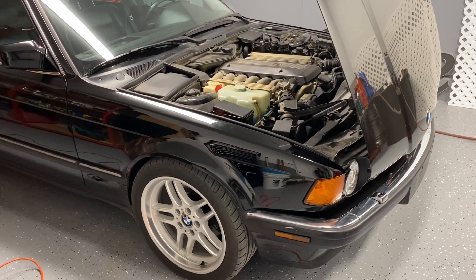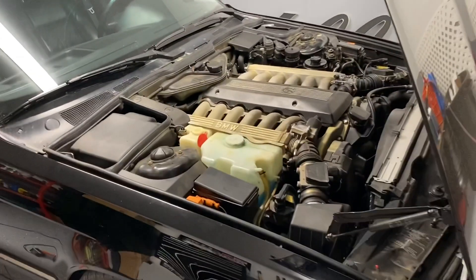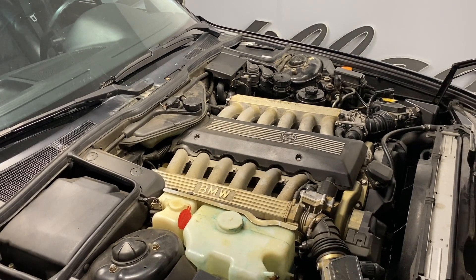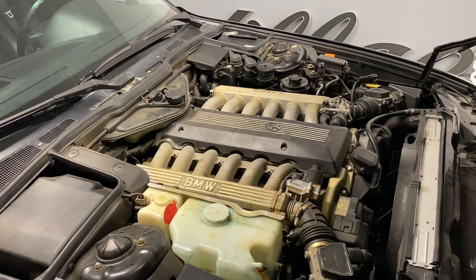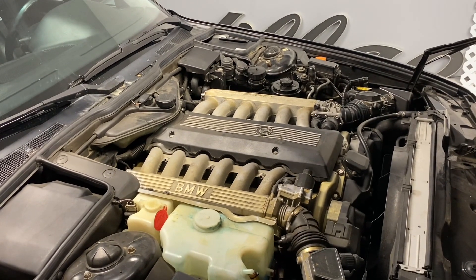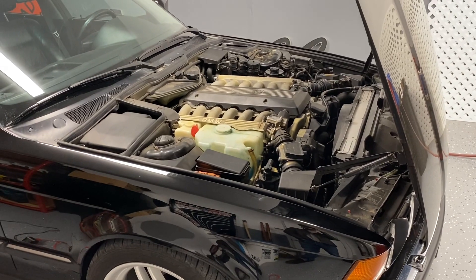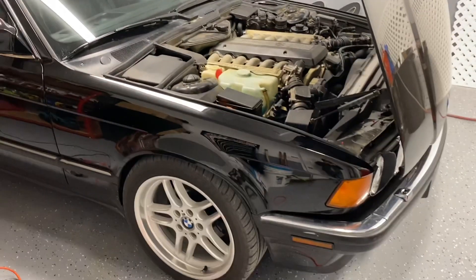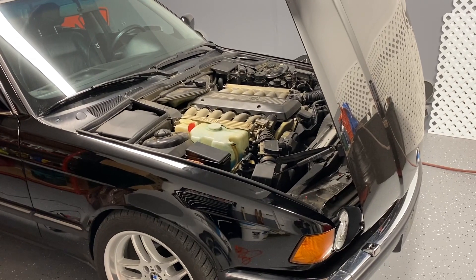That's great because a new hydraulic booster from FCP Euro is $550. A rebuilt one from Jay Stratton — a gentleman who rebuilds these — is about $300 with the core, or he'll rebuild yours for about $130. So this cost me a dollar and thirty-five cents and the gas to go to Napa and buy the O-ring, which I believe was part number 727-626. I'll post the DIY link I used for some tips — that's where I got that part number. Overall it probably took five or six hours to rebuild it in the car versus having to pull the whole thing out. So hopefully this is helpful to somebody. I think they use the same or similar hydraulic boosters on E24s and E28s. Thanks for watching.